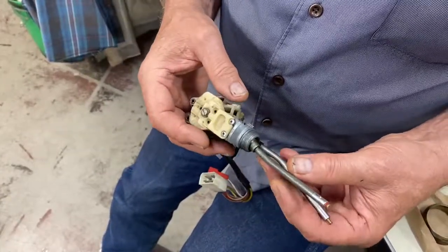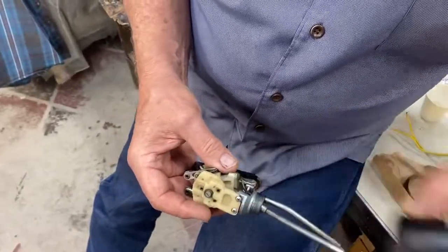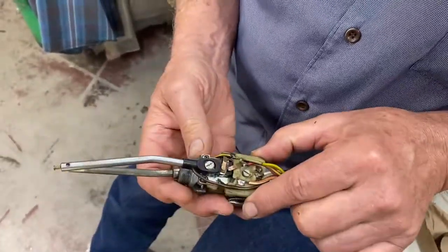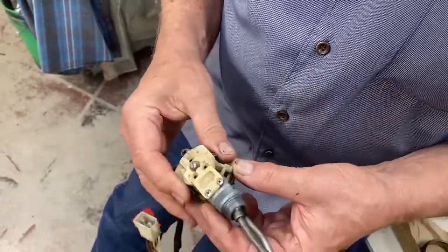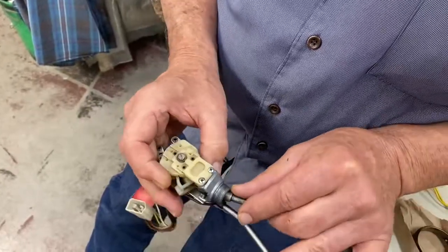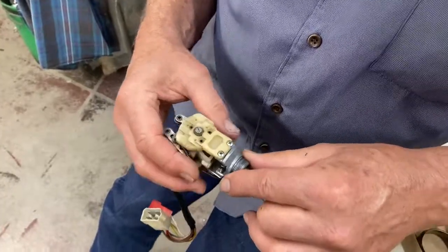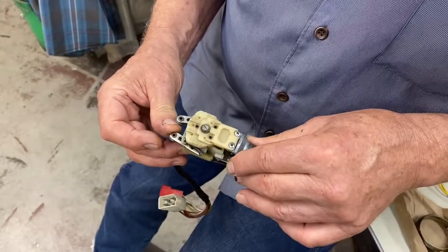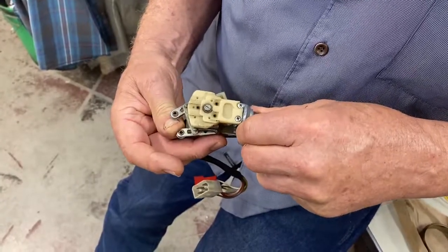Now that we have uncovered the original bell that covers these two units, we can actually see what we're dealing with. The concern is not in the headlamp contacts, which are all claimed to work correctly, nor in the electrical contacts that make the turn signal switch operate. But in fact, the concern is that once operated in one direction, the canceling wheel comes across and hits it, tossing it into the other direction.